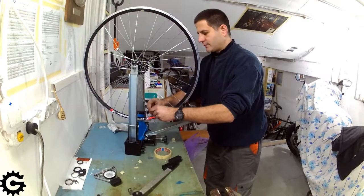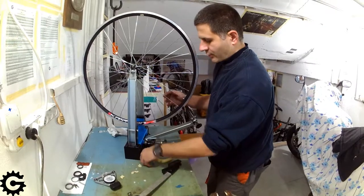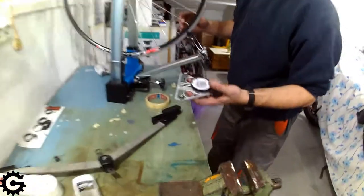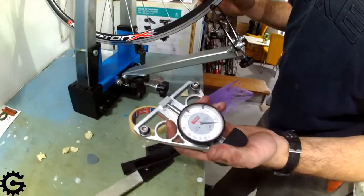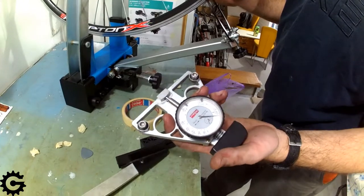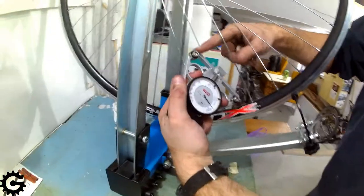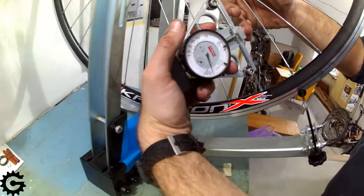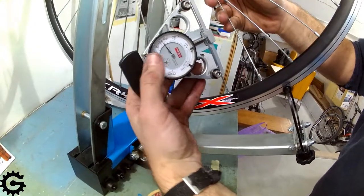And it's often the case that one spoke with lower tension on the left side has its neighbor from the right side also at lower tension, so that they don't make the wheel come untrue, but they don't have the same tension and they're not pulling the same weight. So they will usually unscrew, or the high tension ones will carry a greater load than the other spokes, which are both bad things and make the wheel last shorter.